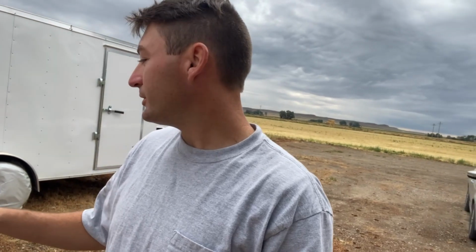He hasn't ran this lawnmower in over a year. The 6-volt battery, yes, thank goodness it is electric start, is dead. So I'm gonna go in and get a battery charger and put on this to charge it. Now, he used it for 3 years and I highly doubt he changed the oil in that time. I'm probably going to try to do an oil change on this. I'm guessing it's a 30 weight, it's Briggs & Stratton. So we'll drain the oil, we'll put new oil in it, get it ready to run.